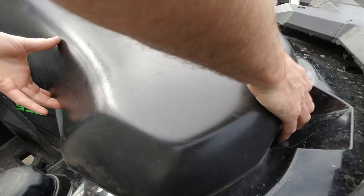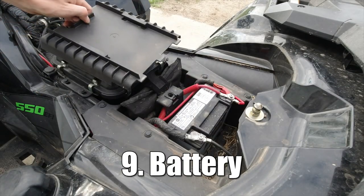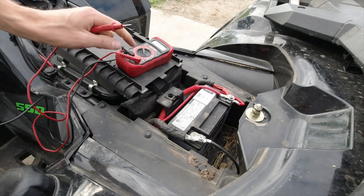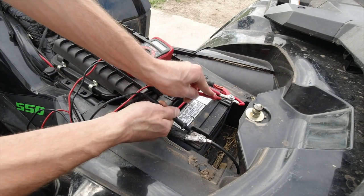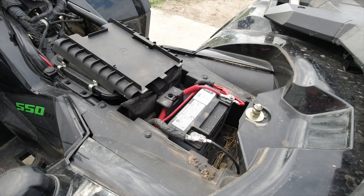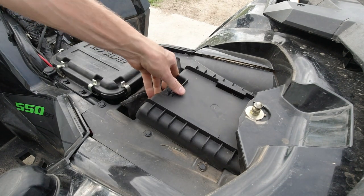Be sure to subscribe so you don't miss it. Number nine is battery voltage. We've got 12.6 here on the gauge. If your gauge doesn't show battery voltage, grab your multimeter, set it to DC — we've got 12.85, which is actually pretty good. If you're anywhere below 12.5, you probably want to start putting it on a maintainer. I'll leave a link in the description below for the maintainer I use and other helpful links.